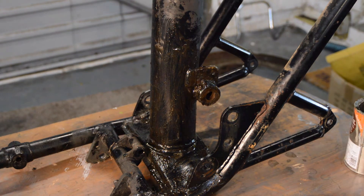After the second coat of paint stripper, the small amount of stuff that's left I've used a wire brush on an angle grinder to get rid of. There are going to be small places you can't get into — those can be finished off by hand, or yet more paint stripper can be flooded into those areas to encourage the last bits out. Alternatively, something like a Dremel can clean up every last tiny nook and cranny.